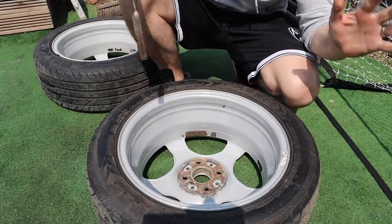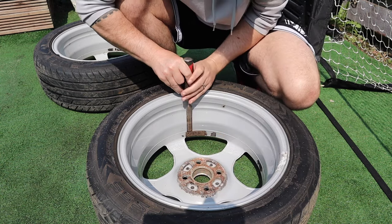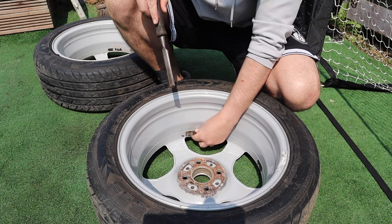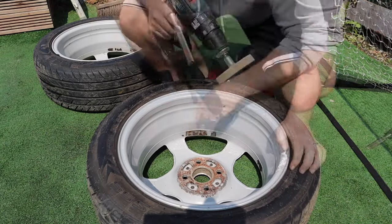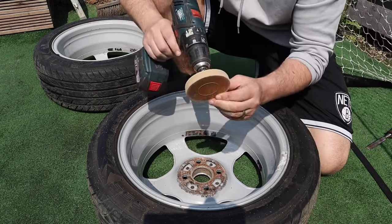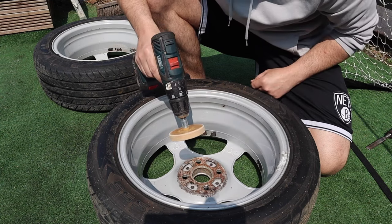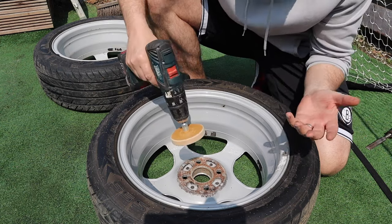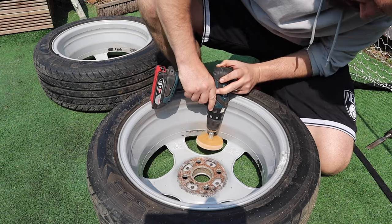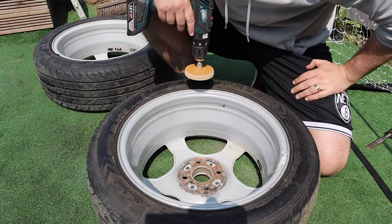To remove the weights I've got a chisel. I'm going to go in between the weight and the sticky backing plate to just pry it off — nice and easy, no damage, and then you can just pick it off. However you are left with this horrible sticky mess. That sticky mess can be a pain to get rid of unless you get one of these, which is called a caramel wheel or a toffee wheel. You can pick them up for about five or six pounds on Amazon — I'll link it below. All it does is basically rip all the remaining sticker off. It's great as well if you've got decals on your car that you want rid of or you're doing a debadging. You just use the corner of the wheel and it'll take everything off, then a quick wipe with white spirit to get rid of any more residue and you're good to go.